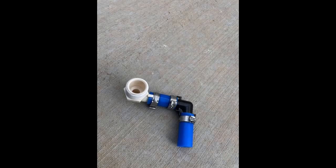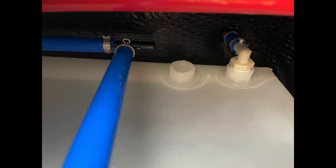The space between the top of the fresh water tank and the bottom of the floor is very minimal — only about an inch and a half to two inches. That doesn't leave much room to install parts; however, there's just enough to get the PEX lines up above the fresh water tank to break the siphon, which is the goal. It is a tight squeeze to get PEX crimpers in there, so if you can build some of the pieces outside and then install them, that's the best approach.